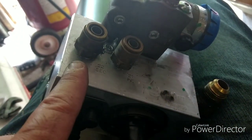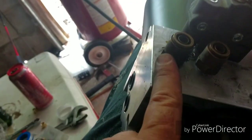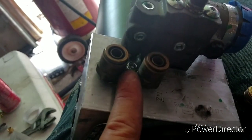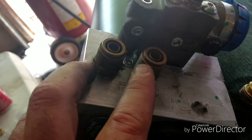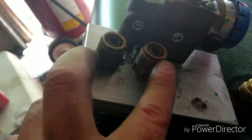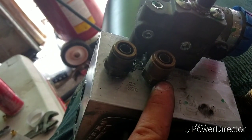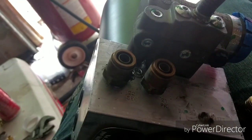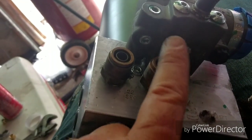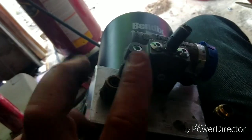Now, if you're getting either only air in the primary or only air in the secondary, you can come down here and unhook these and see if there's air here. If you got air coming out here to whatever system is not getting air, then you got a plug further out from this. Probably in the crossover box. There'll be a crossover box up above your tanks, and that's probably what it is if you're getting air out of both of these. If there's no air coming out of this, then again, this unit's bad. Replace it.